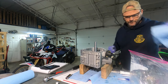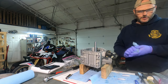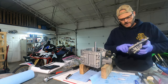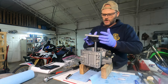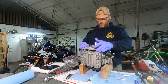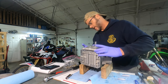Getting that lined on there. I'm going to go ahead and change out these gloves to get that stuff off so I can work with my tools. We have our locating dowels put in. Time to reinstall the back plate. There is a bearing in here, and I'm going to go ahead and put a little bit of grease on this external seal. When installing this governor, you have to make sure that it matches the gears. If you feel something in a bind, don't force it — it should go all the way down. You may have to turn it back and forth a little bit because that governor gear will have to align and then it should drop onto your pins.